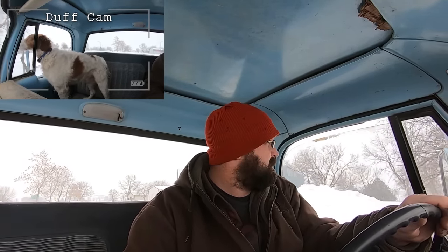Professional axes. Anybody know anything about these? What are they? 465 transmissions or whatever these things are? 435? Going into second is always just stiff as a brick. Oh, just super boggy. We got something screwed up with the timing. Rolling my window up. You want yours up? Guess not. Yeah, second gear, it's always been tough to pull in on this.